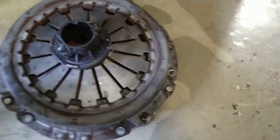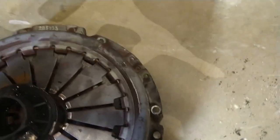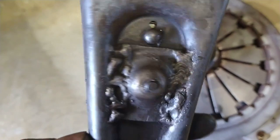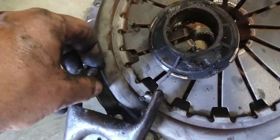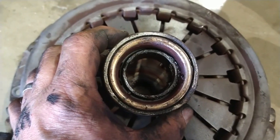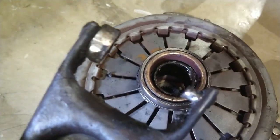Look at that - that needs a bit of cleaning. Do we recognize what this is, and should it look like this? I'm not sure it should. Something wasn't very kosher. So this arm - I don't know if this is standard coming from the factory, you never know from Sully Hill. So this was grinding - you can see that there. This whole piece is missing on this side, which is really weird. That was fine on this side, but here it was starting to groove in there, also causing the thrust bearing to sit skew, so it's not fully round anymore. That's the problem - pushing the clutch pedal in halfway and then it just got stuck and you couldn't change gears anymore.